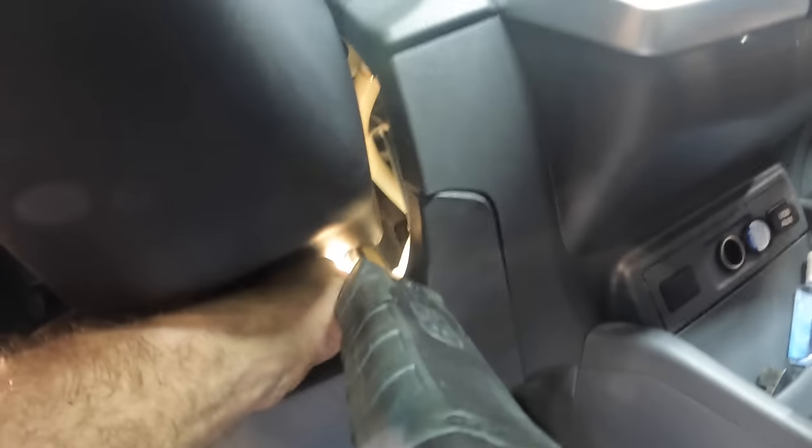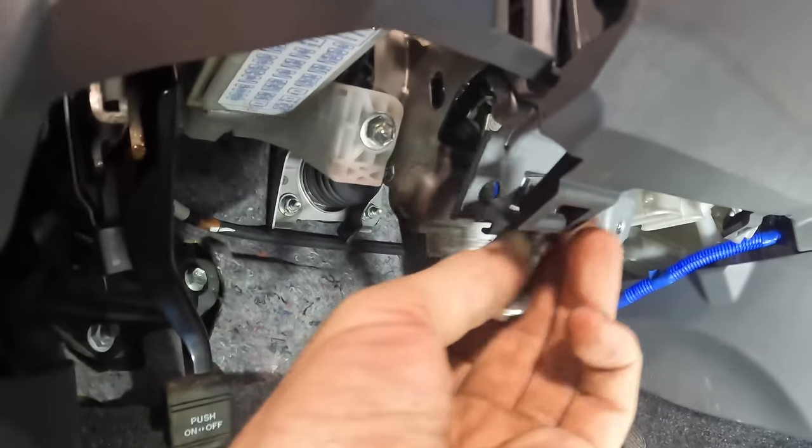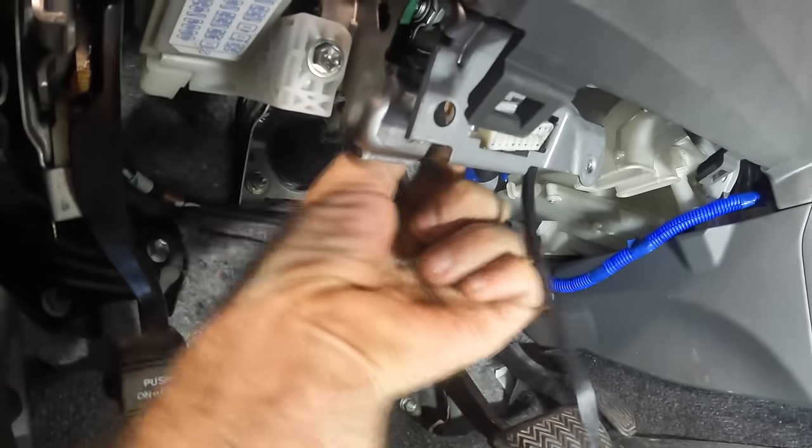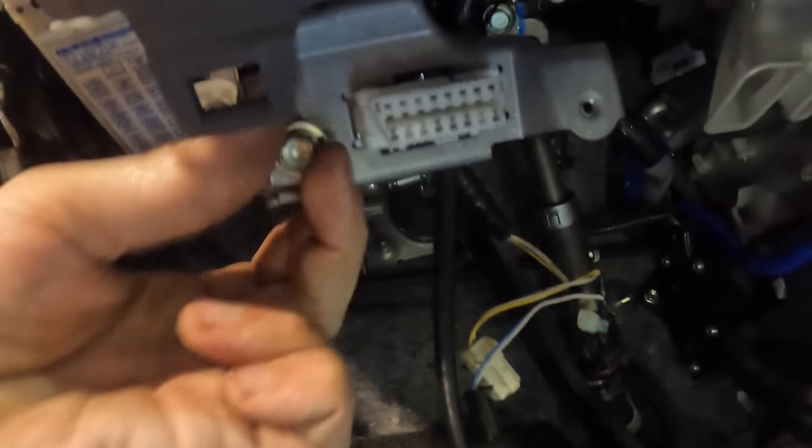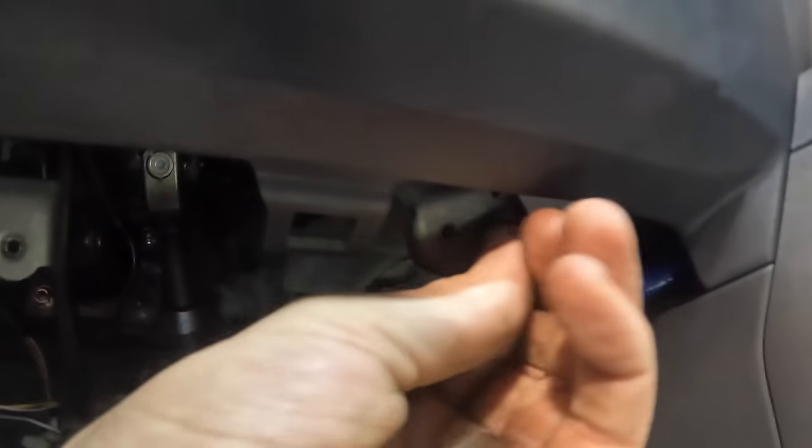Okay, that's one of the top bolts right there. And the second top bolt goes in way, way back there. You barely even see it. Come here, light. There. Okay, that top bolt's in. Got two more go in down here at the bottom. One right here. Oh, here, let's run the OBD connection through while we're at it. Connect that right there. Okay, bottom bolt. Let's get this guy lined up. That one there. And then the fourth one, back over there in that corner. Beautiful.